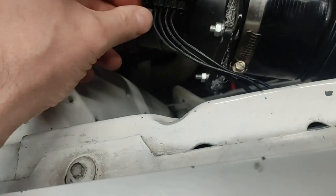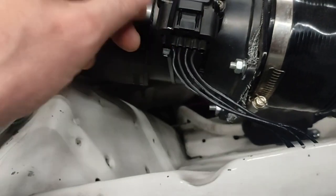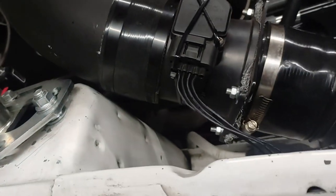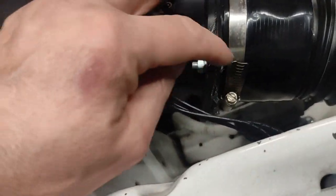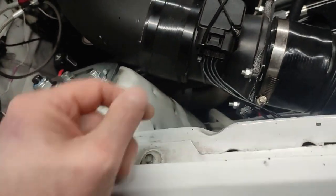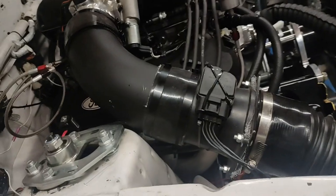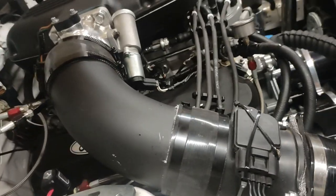That is the update. I've got this over here securing the sensor — these can just be popped off, but this was just to hold it down nice and tight while the glue was setting up last night. The only reason I did that is the tuner has me run some screens in front of the MAF to straighten out the airflow. To do that, I'd have to take out the screens and everything else to spray it from that side — it's easier to just take the sensor out from the top and drop it back in. It wasn't really dirty, but I just sprayed it with throttle cleaner to knock that out of the equation.